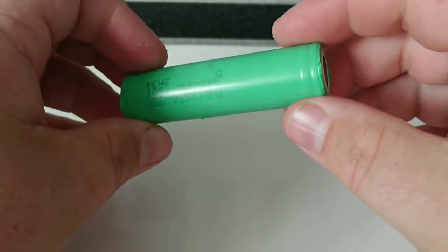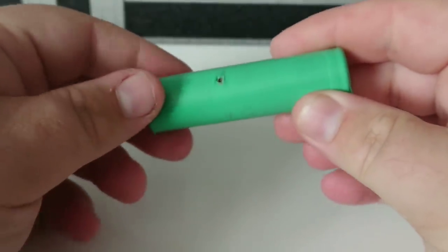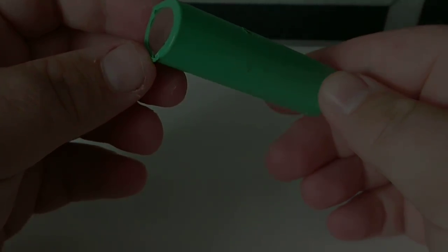Normally I would say if the battery is starting to diminish, just dispose of it safely, but on this occasion I'm going to rewrap it. What I'm doing here is taking the battery wrap off. The most effective way to take it off is just to rip it. The likelihood is, unless you're changing wraps for style reasons, it's already got a tear in it anyway — so just take it from that tear and rip right up to the top of the battery.